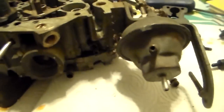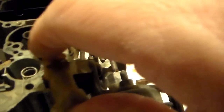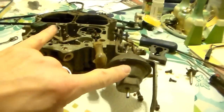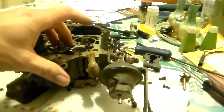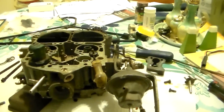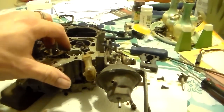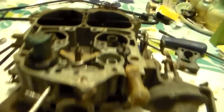It's not that mysterious, is it? And of course if you had to replace your TPS, you simply slip it back in there - make sure the spring is in there. So it's not quite as bad as you thought. You've just got two little electrical devices in here and a couple of adjustments you can make, and once you do that you ought to be able to fine-tune one of these. Google has some good resources on how to tune one of these. I never got into fine-tuning - I just did the adjustment to the TPS, set it back to factory specs, and it always seemed to work well.